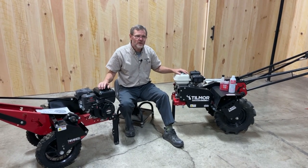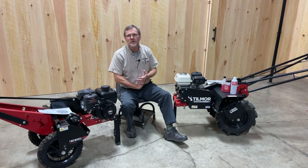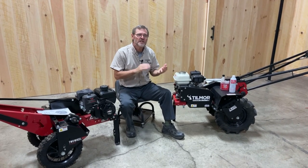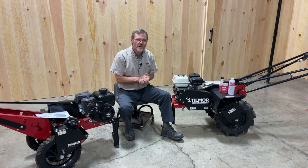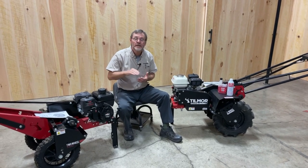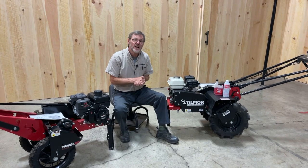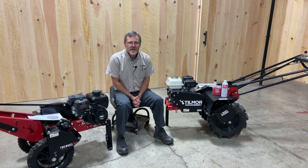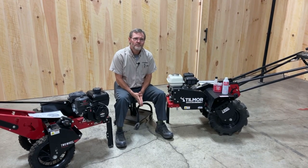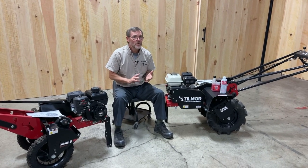So today I want to focus on small engines and fuel, because that is usually where the issues or the problems arise. And we have gotten calls this past year. For example, if your engine happens to surge, that is a sign of probably some gummy substance inside your carburetor. And in talking with small engine repair people, they will highly recommend using clean fuel and no ethanol.